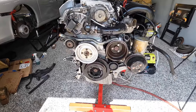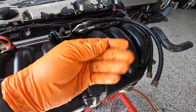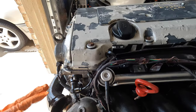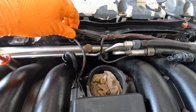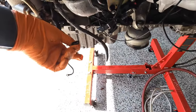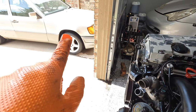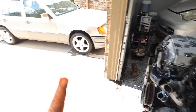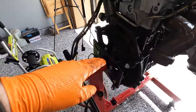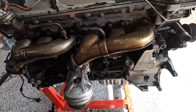All right, that seems better — certainly cleaner than it was. It's still pretty wet so it's hard to tell, but rubbing my hands on the plastic and on what's left of the paint on this magnesium valve cover, it's pretty good. The wiring is cleaner — you can clearly see this is a biodegradable wiring harness and the fabric is pretty wasted. Some of the wiring harness has been cut as well. I believe this is the lower wiring harness, so I'll be pulling that from Gunther and putting it in the replacement engine. I think I got really lucky on this engine because it is in really good shape aside from the obvious leaks — the rear main seal and the oil pan gasket, which I think is leaking as well. Nothing on the cylinder head, so that's really good.